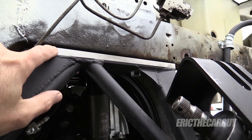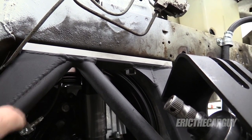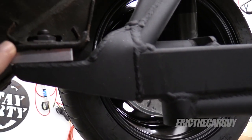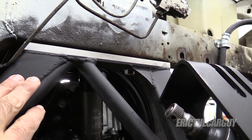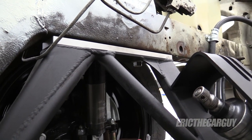As you may have already noticed, I have these half-inch spacers between the K-member and the body of the vehicle. I've done this so that I can lower the engine down enough so that I can get hood clearance. This is actually successful, as you'll see in future episodes. So this might be something you can do if you're having trouble with hood clearance and you don't want to cut holes in your hood.